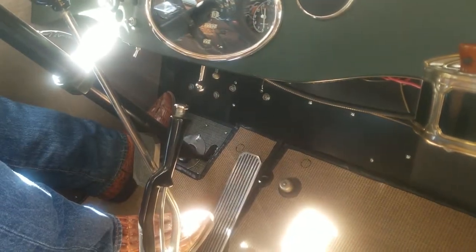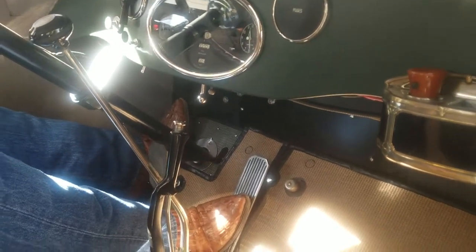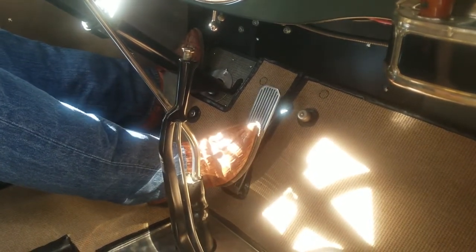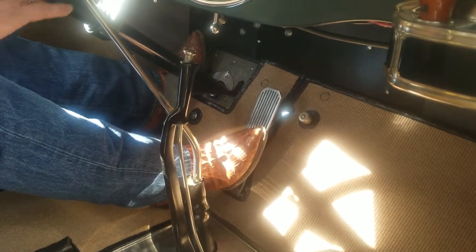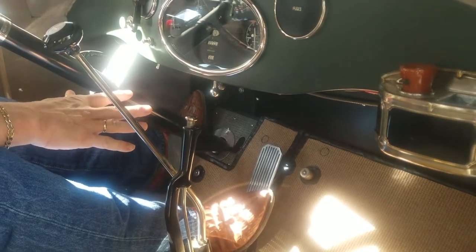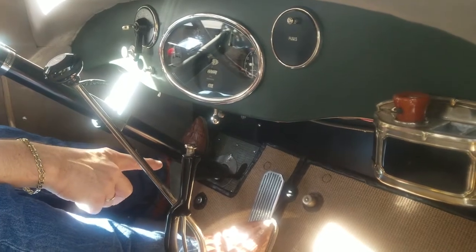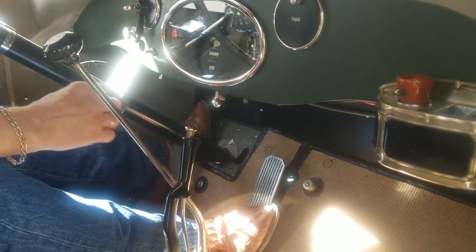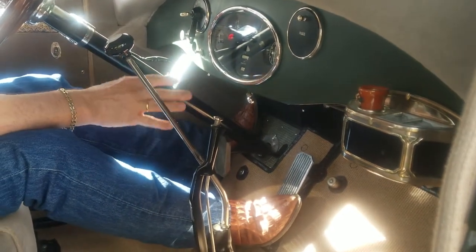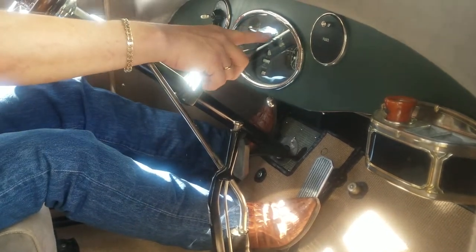And it will start right up. Now, the one thing you'll find is it'll almost always be, even with just one pump of gas, we've actually got a little too much gas in the engine when we start up. If you're on choke, you've got to shut the choke off within seconds or you're going to flood this car. So if you flood it, it's because you got the choke on or you've done more than one pump of gas. We'll let it run for a couple minutes normally. Once it runs for a couple minutes, things tend to smooth out and it gets nice. But basically what's happening is you almost always are giving it a little too much gas when you're starting it up. Immediately check your oil pressure.